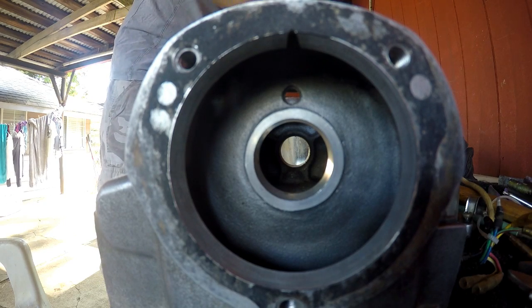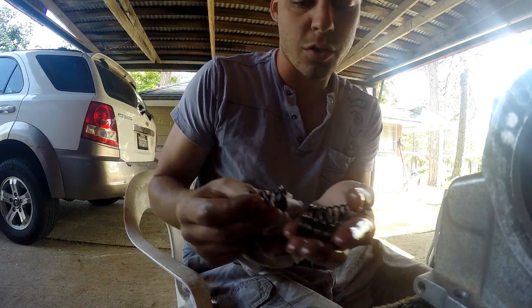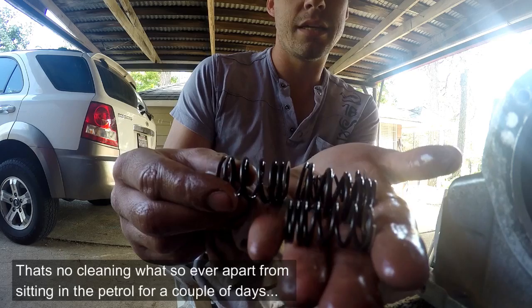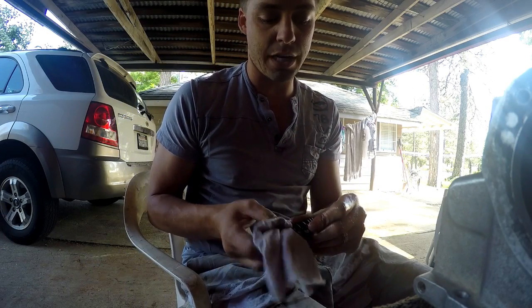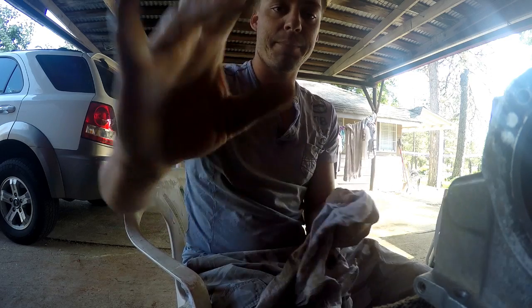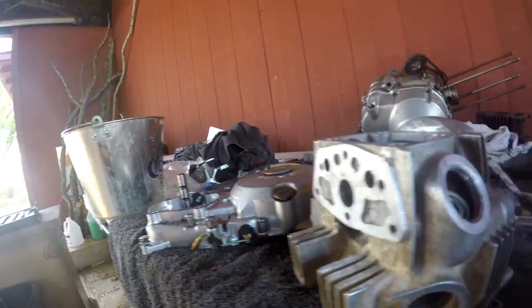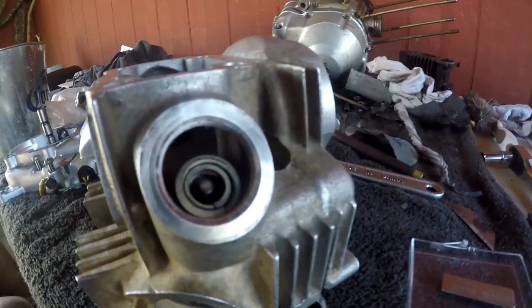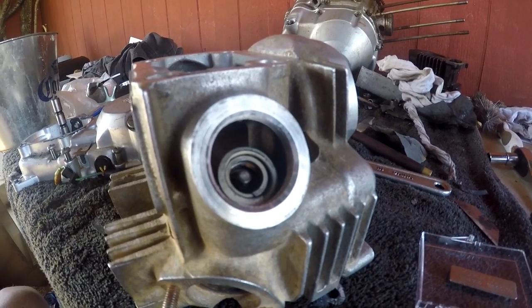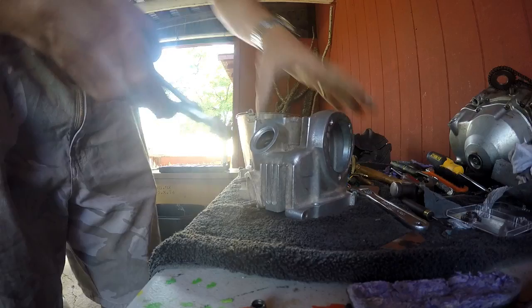Let's see how the valve springs came out of the gas. I can tell which one is dirty but only barely, so I'm just gonna go ahead and wipe these down - dirt came right off of them. Then I'm gonna go ahead and reseat them and put them all back in exactly like I showed you how to take them out. So I just wiped the valve springs down and they're back in now. The valve seat has got to go in and push right in over here, and of course I've got to get these two little metal bits that are sitting right over here - I'm gonna have to push the valve seat in and then push those two in together. A lot of guys say that you need a valve compressor tool - I'm gonna try and do it without the tool. It was quite successful getting it out, but let's see how we do getting it back in.